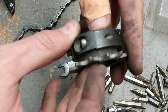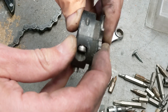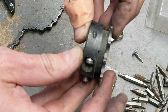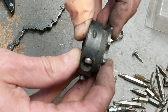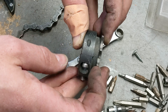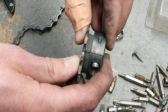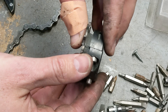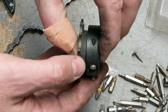This is why it broke even at version three. The way they designed this thing is that if you crank it on the shaft the wrong way, because there's so much play, you're going to have the teeth not aligning properly and you're going to eat up the chain. The same on this side — that hole is too big. So even in version three they definitely have points of failure. This is quite disappointing.